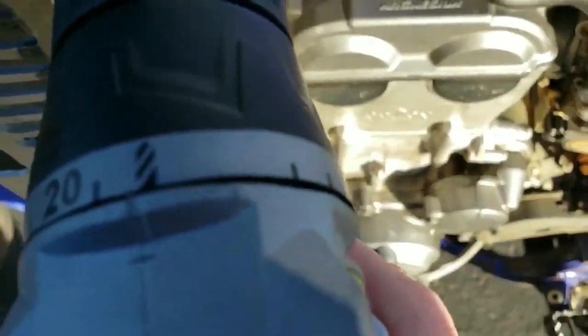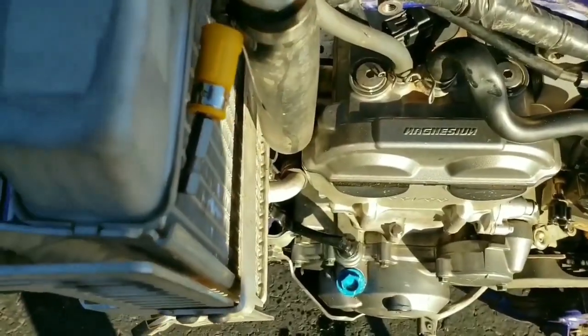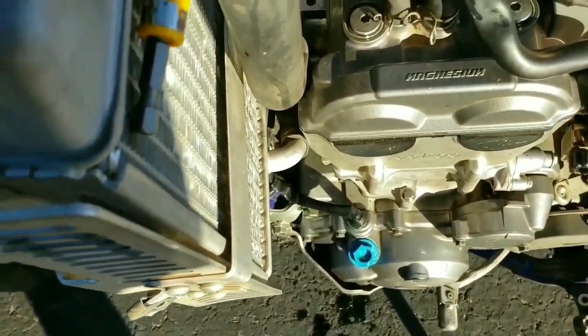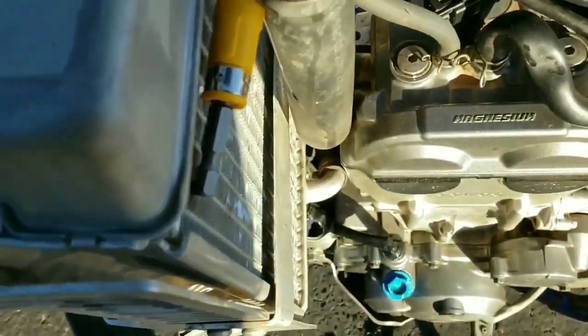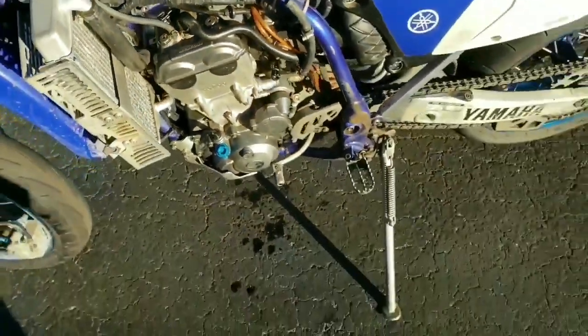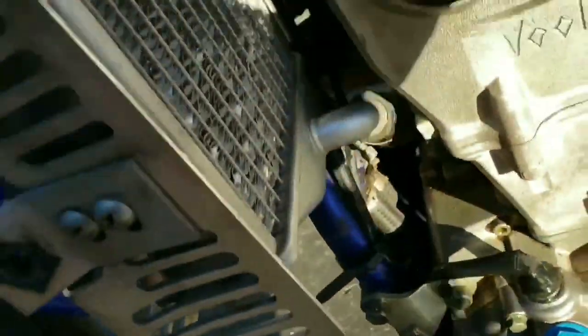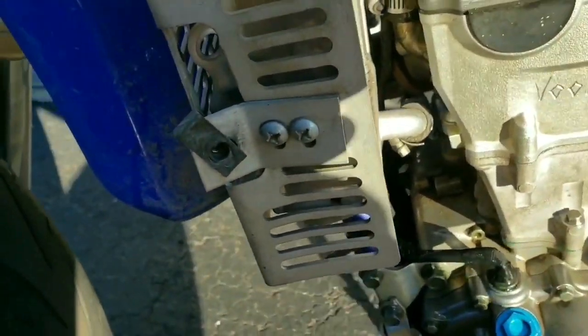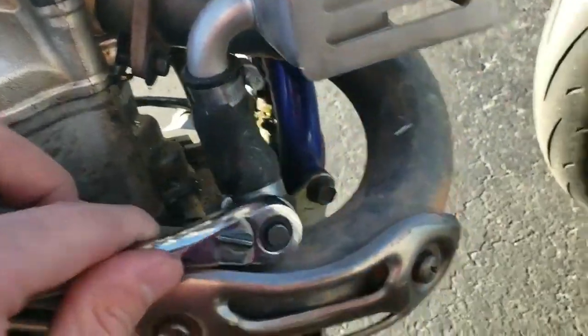I'll try a good firm squeeze first. I think that was it — I think it was just loose. It felt pretty hand tight on there, but it stopped the bubbling. I also have to fill it back up with coolant and take it out for another ride. I'm going to go ahead and tighten all the other ones while we're at it, because maybe some of the others aren't very tight either. I think that definitely was the issue — most of these are not on very tight.